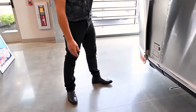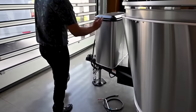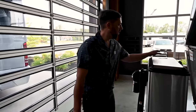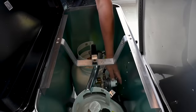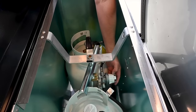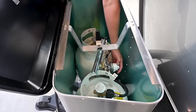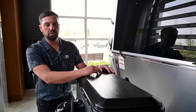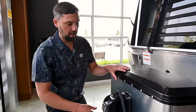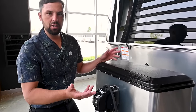There's also a VIN plate with tire information and tire pressure. On the other side, there are two 20-pound propane bottles on board with a regulator you can switch left to right. Open the cover to see the tanks, the regulator, and a little indicator — red means the tanks are empty. We fill them when you pick up the trailer. The automatic switchover means if one bottle gets empty it switches to the other. The bottle cover is removable so you can take propane bottles out to get refilled or exchanged — these are standard exchangeable size.